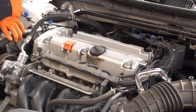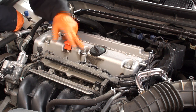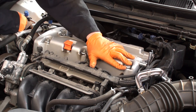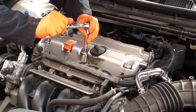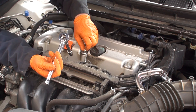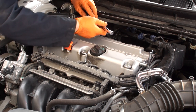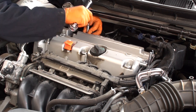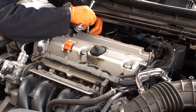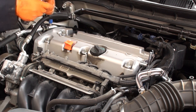What we're going to do next is unscrew the screws securing the valve cover to the cylinder head — that is done by undoing all six screws. Be careful when undoing these because you don't want to drop these cap nuts down into the spark plug holes, otherwise you're going to have to get a tool to fish them out. You don't actually need to remove the spark plugs on this engine, just because the spark plugs are on the head and not the actual valve cover itself.